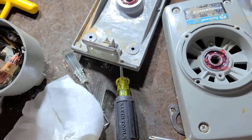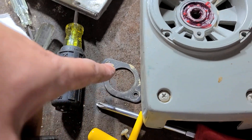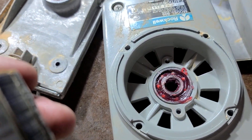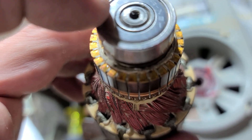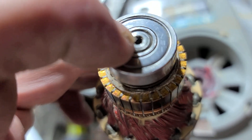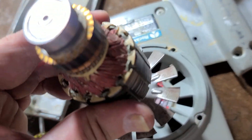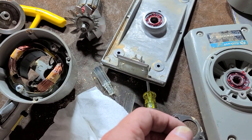The last thing — and the most difficult — is making sure that you get the retaining washer on there before you push in the motor. That's always annoying when you forget that. And then of course, tapping in the motor carefully, not to damage this upper bearing, using a punch right in that recess or something to tap this motor back down into that housing, and then reassemble.